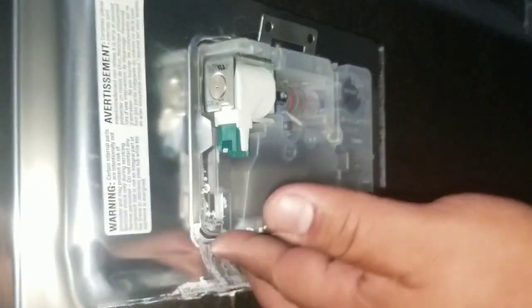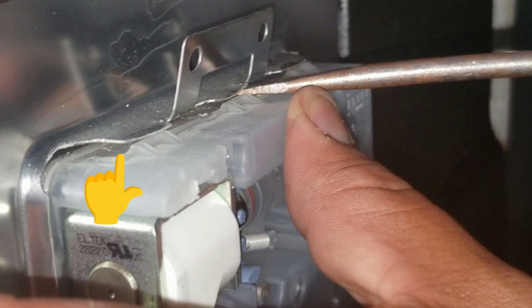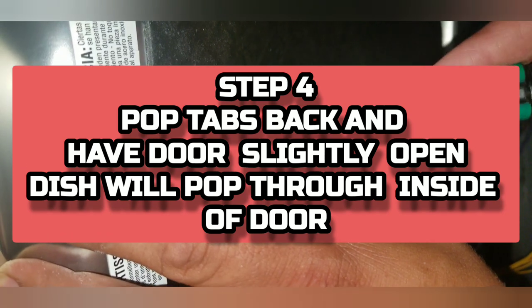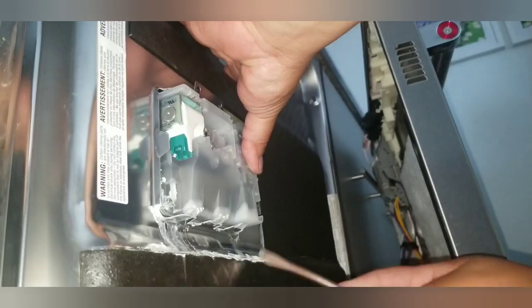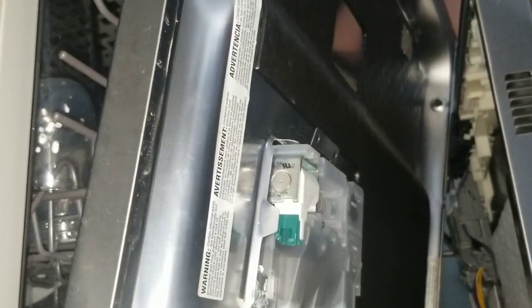That is soap that was leaking through the dishwasher, so this dishwasher was broken in two ways — the door was broken and soap was leaking. Now there are these little retainers on the stainless steel door. Don't bend them out of shape too much because then they won't hold in your new dispenser with pressure. Pop them off one at a time. You can take a razor blade and carefully cut the plastic out around the soap dish, or take a putty knife or screwdriver and pop the metal tab slightly down and push it in until it unclips. Open the door and stick a towel in the top to keep some space between the rack and the dispenser — that will allow the dispenser to pop right into the machine and get out of your way.